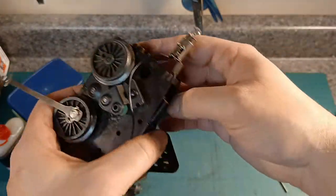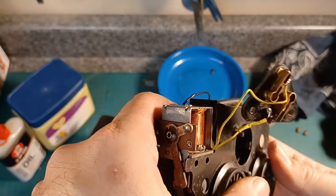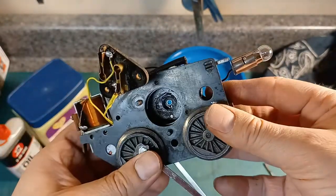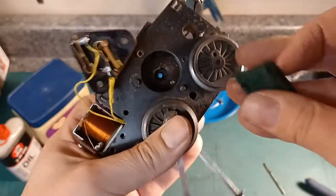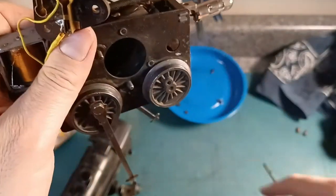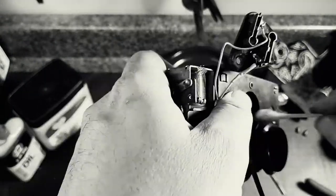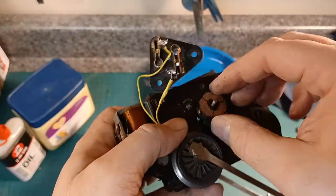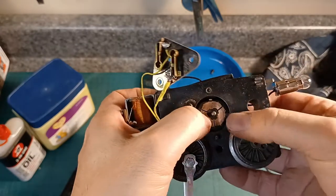We can have a look at the back of this to see what kind of carbon buildup we got — and there is some there. So I'll just get my rag and give it a bit of a wipe. Let me have a look inside there. It's a little bit greasy looking in there — not too bad, I've seen much, much worse. But while it's out, you can take your green pad and wipe the field pieces — I think they're magnet fields, the silver things in here that the armature spins against. If one of you guys know what it's called, you can put it in the comments. While it's out, you can give them a quick little wipe too. And you can drop that back in.